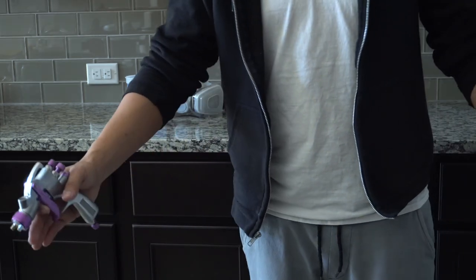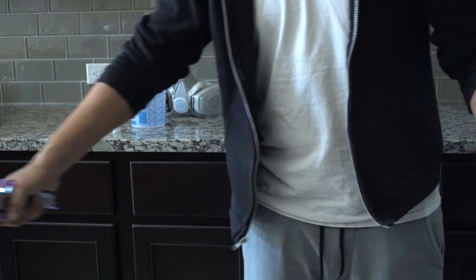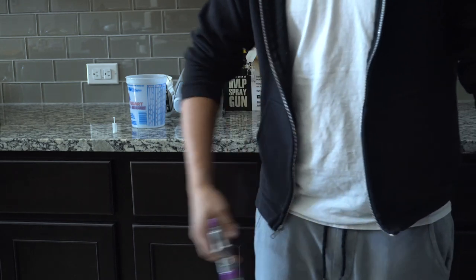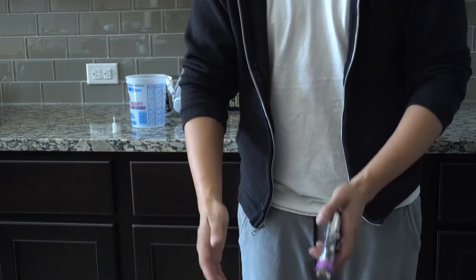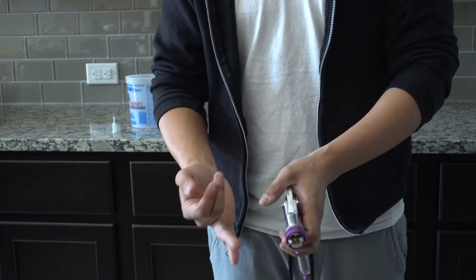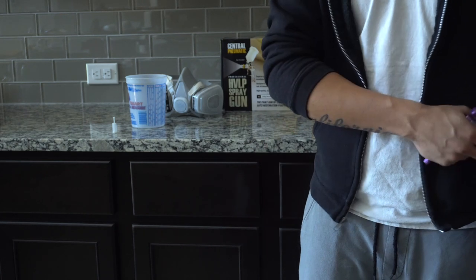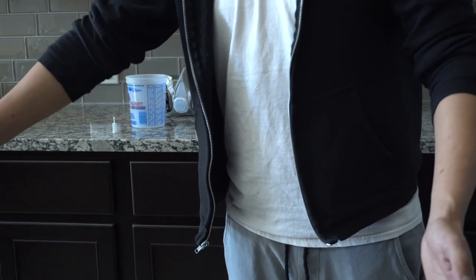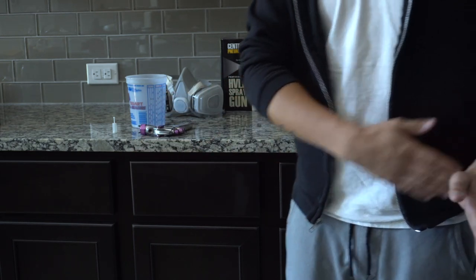Whenever you're spraying any panel of the vehicle, you want to spray the entire length of it in one pass. You never want to stop halfway and then meet it up from the other side, because essentially what you're creating is a high spot for sags and drips, and obviously, even if you get all those drips out, you're disturbing the flow of the actual paint. So just remember to never stop halfway.